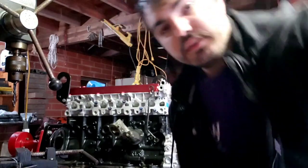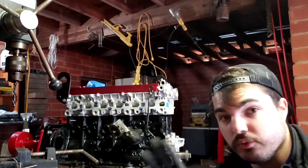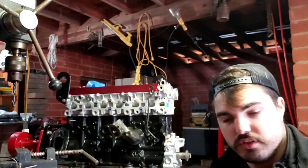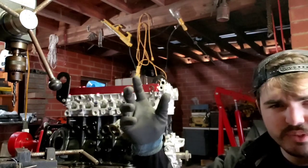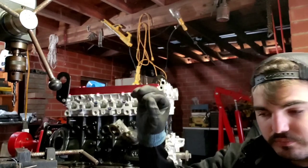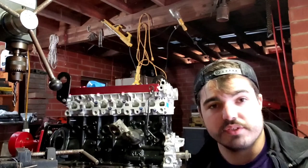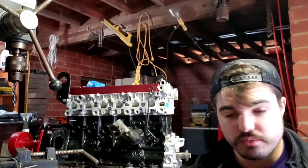So yeah, boost control is a bit different because you have your wastegate that controls your turbine speed and your boost pressure normally. What I'm going to do is have an electronic throttle body on my charge pipe to control just boost pressure. Then I can have the electronic wastegate by TurboSmart, like the EWG60 or something, control the turbine speed, and that'll go through my intercooler and all that. And then I'll have the electronic throttle body as a controlled boost leak to bleed off boost pressure, even though my turbo is spinning at high RPM, making boost pressure before my intercooler.